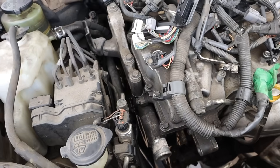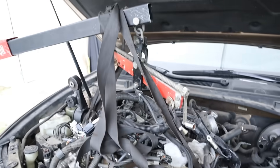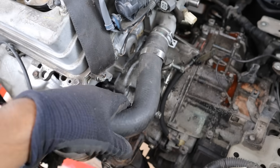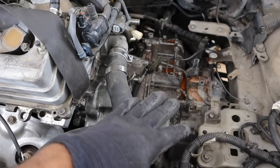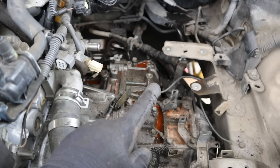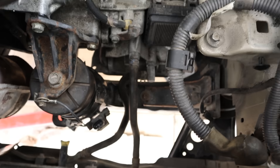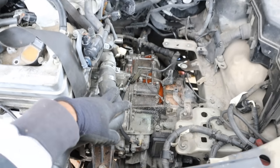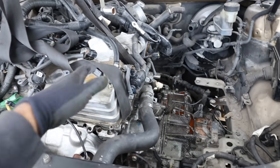I'm hoping I have enough clearance on this side to get it off the transmission dowels. I've got the engine crane on there but I'm having a hell of a time breaking the transmission loose at the bell housing. So what I might do is actually pull the transmission with it — it's just a shifter linkage, an axle at the back, a transmission mount on the side, and two coolant lines and a mount at the front. Once I get that done I'm going to see if I can tilt this and get it out somehow.